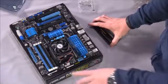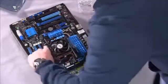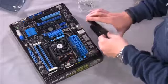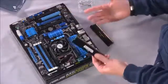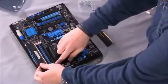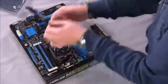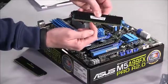We've kind of standardized now so that if you look at the PCB, you can probably see where it will say DIMM A1, A2, B1, B2. So you kind of fill that up in the order that makes sense. We're going to put a module into A1 and B1. So A channel and B channel both have a memory module filled for the best performance. The DIMMs along the bottom, these are DDR3 1600 DIMMs actually. And you'll notice that there is a notch on them. Maybe it's better to show on this, you'll see along the bottom there's a notch right here.